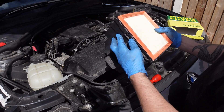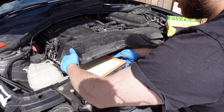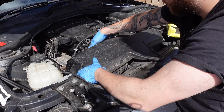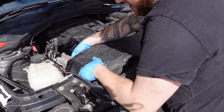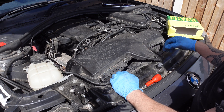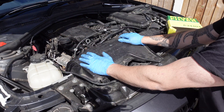Let's try and get this back in. As far as I'm aware there isn't a particular orientation this has to go in. Air box going back in — make sure it's slotted on there properly. This is the not-so-easy bit, trying to get this to actually sit under there properly and connect, especially when the car's jacked up and it's high. Just be patient and keep going because you'll get there eventually. Then push it back down into these rubber things — that's your air filter done.